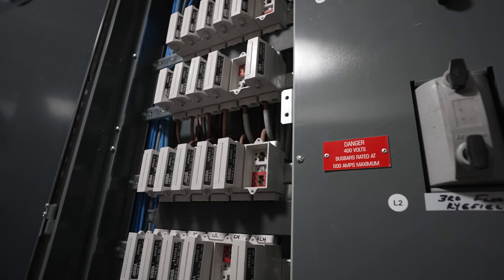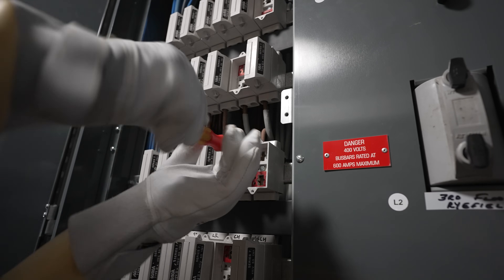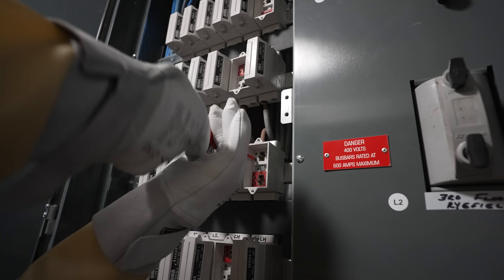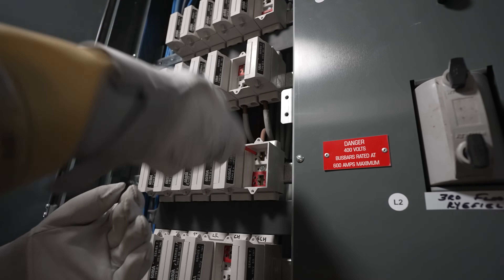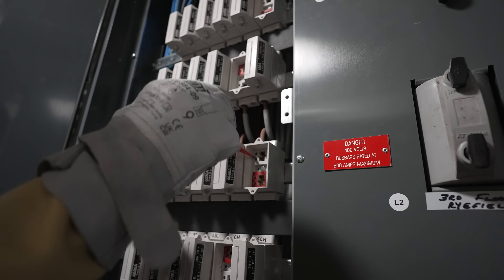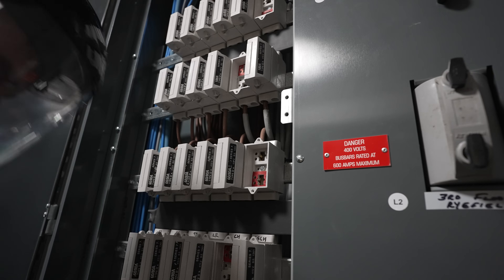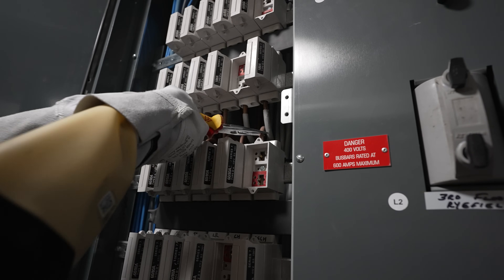We're going to use this way, but strangely enough there is another one in here — there's a tail in here but it's not doing anything obviously because the fuse is out, so we're going to remove that and we're just going to tape it up out of the way.